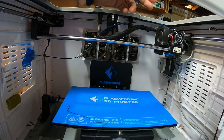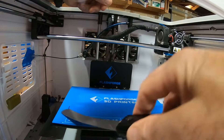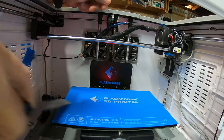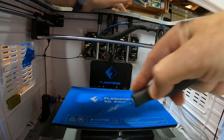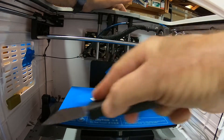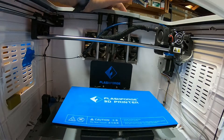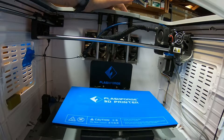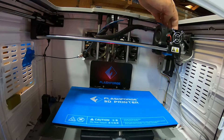I'm also using this outline and you can see it comes right off. When I was using the brass nozzles it would often stick to the print bed. This basically comes off just by pulling it, making cleanup a lot easier. With the brass nozzles I had big sections of the outline stuck to the bed. A trick I showed in another video: to clean your print bed when a print sticks, just heat it up higher than the melting point of the filament and you can peel it right off without scraping, which would affect surface roughness.